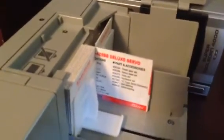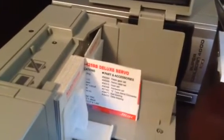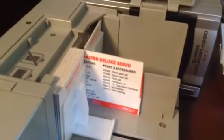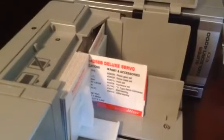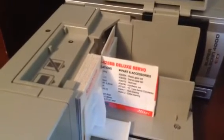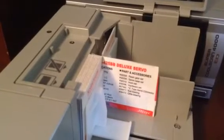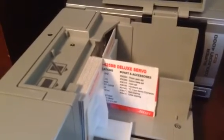If you look at the magazine of the SF200 closely, you will see that I have narrowed the feed slot somewhat by putting a fairly rigid piece of cardboard along the side toward the scanning device. This is because with thin paper slides, more than one slide is occasionally fed in, and this jams the machine. With thicker slides — those which have metal mounts — that's not necessary, and this simple piece of cardboard would just be removed. It's only taped there with some scotch tape.